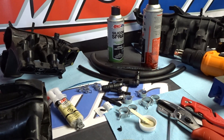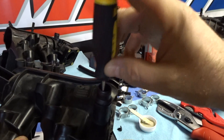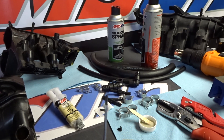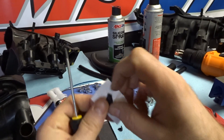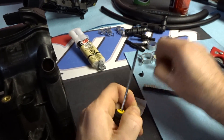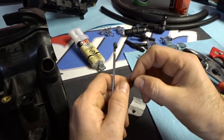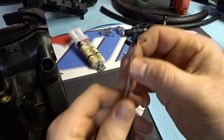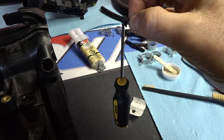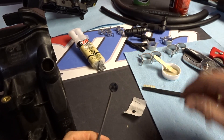After scrubbing, blow it out with some air and look down there to make sure it's flat, not oily, has a matte finish, and is dry — you don't want it to be wet when you start. Next, get a thin flathead screwdriver and make sure it's long enough by sticking it down the port to confirm it doesn't bottom out in the handle. Clean the screwdriver with parts cleaner too, then grab some butyl rubber — just a little — and dab it onto the screwdriver. Stick the clip onto it with the flat edge facing down, at about the same height as the screwdriver tip.